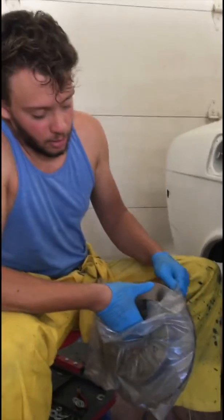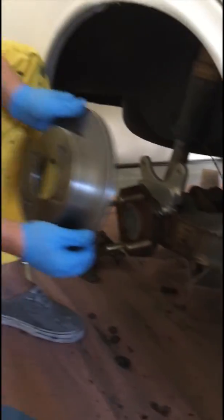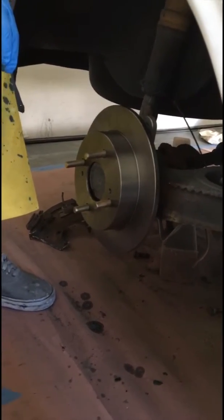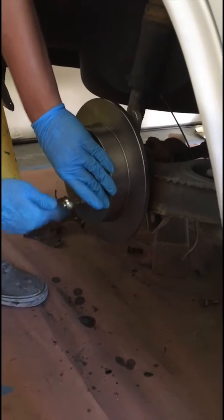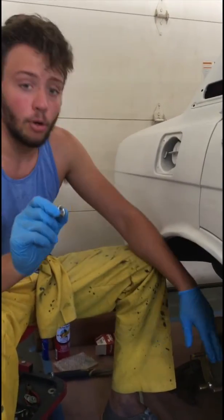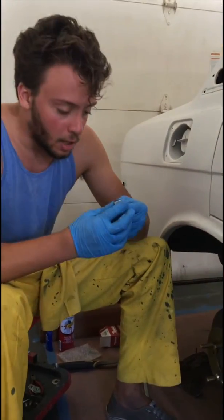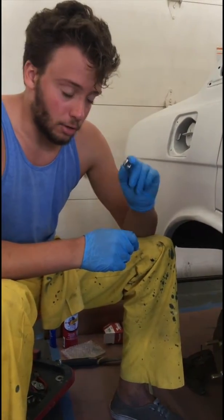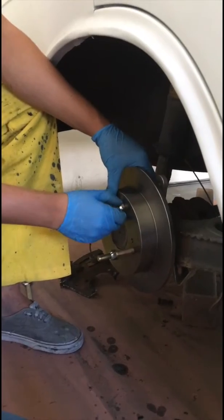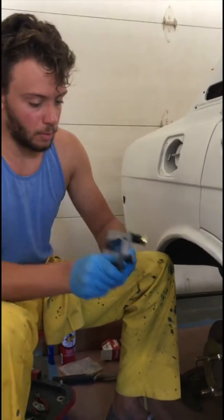These brakes are from a 1982 to 1983 Nissan 280ZX, but thanks to this caliper bracket we're able to make the rear disc brake conversion. Just slide these on, and it'll make things easier if you use one bolt just to keep it in place while you're doing the rest of your work. Also, as a tip: these are the nuts I pulled the studs through, and you don't want to use these on the actual wheels because I just put a very large amount of torque on these. If you mess up any of the threads, you really don't want that when you're cruising down the road at high speeds. They're just a few bucks, so as a safety tip, try to get different nuts for the actual wheel. Now that we have the rotor on, we can put the caliper bracket on, and then we will attach the caliper.